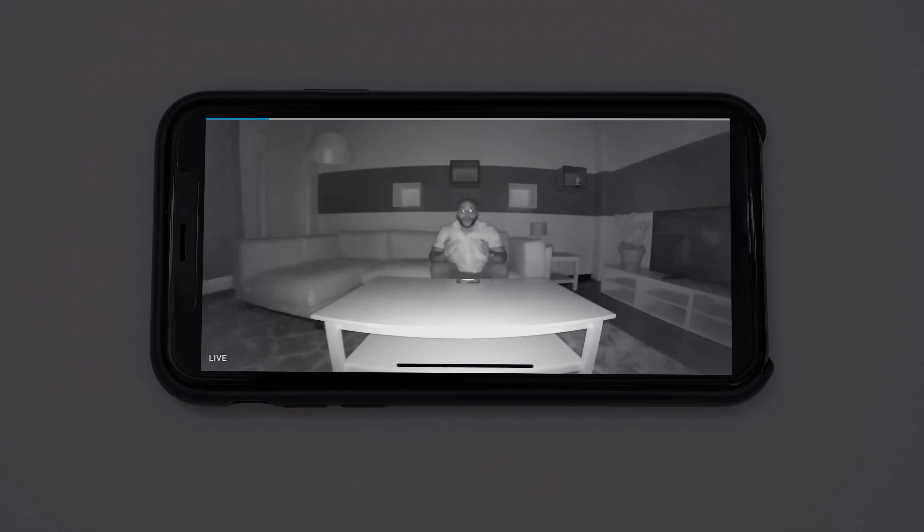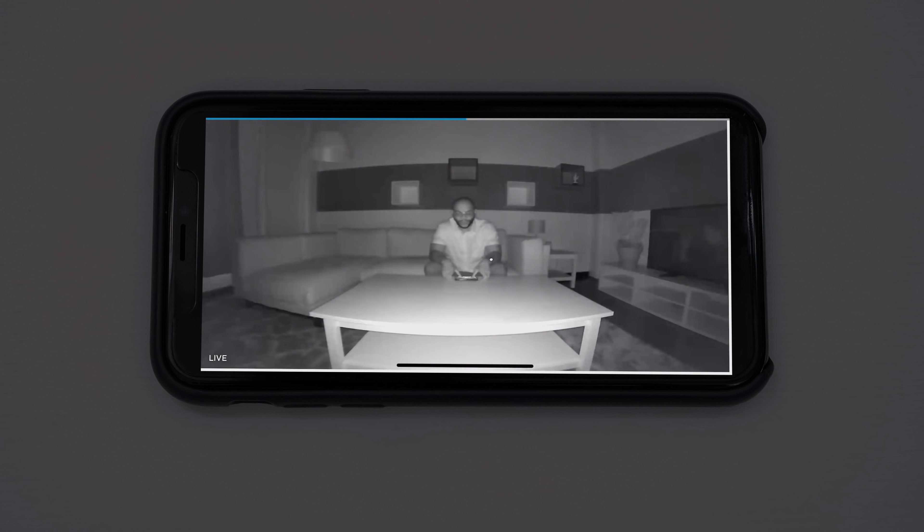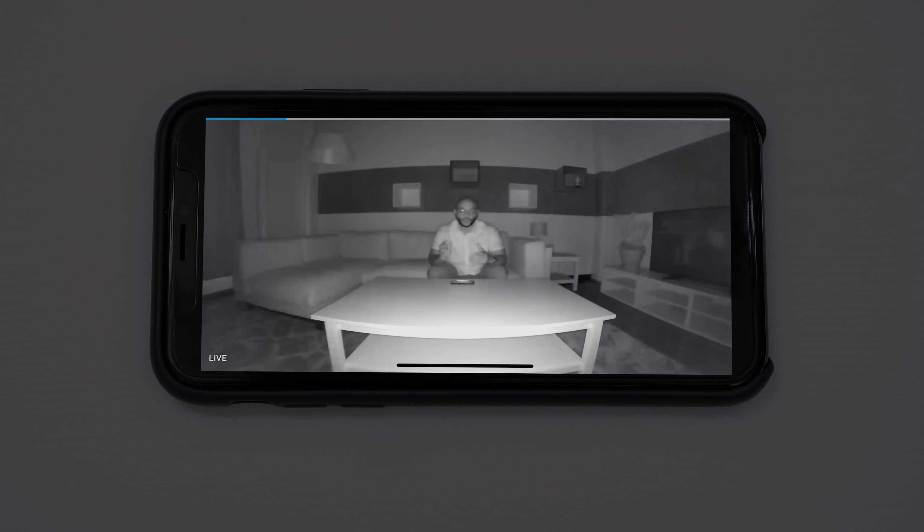We want to show you the night vision on the Honeywell Lyric C2 security camera. As you can see right from the outset, it's not particularly clear — it's much more blurry than some of the other cameras we've seen. This may be due to the fact that while it does have LED infrared sensors, there are only four on the camera, whereas other cameras seem to have a lot more. Even with digital zoom, you can see how unwell the image looks. As you can see from the video, it just went out — we're not exactly sure why it tends to go off during night vision, but a live stream going off in the middle of watching something at night is a concern.